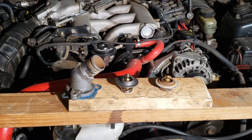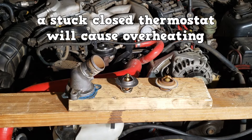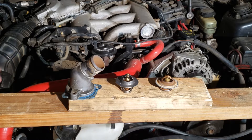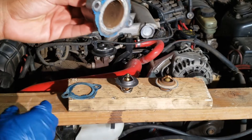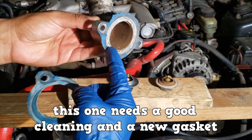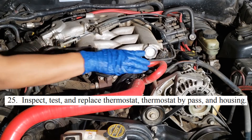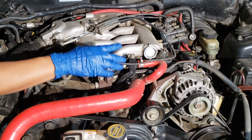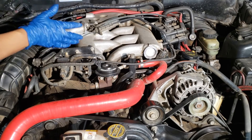So far we focused on the AC system. The A7 will also ask you basic questions about the cooling system. A stuck closed thermostat will cause overheating. What are the symptoms of a stuck open thermostat? A thermostat with a removable housing can leak at the sealing surface due to a failed gasket or due to corrosion and pitting. The bypass hose is usually the route the coolant takes when the engine is warming up, when the thermostat is closed. These are often neglected and become a leak source, because sometimes they are in a hard to reach place.